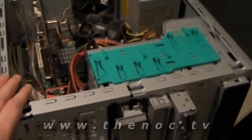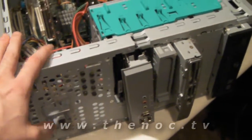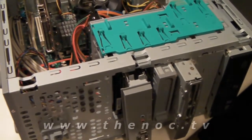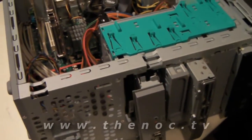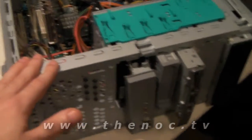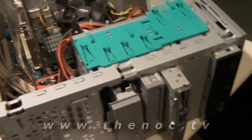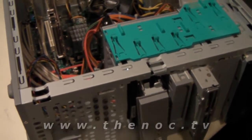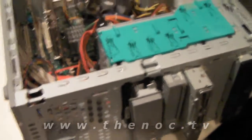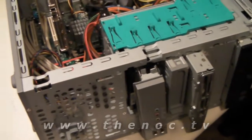You may have a computer that's starting up, runs for a few minutes and then it either locks up, freezes, or just powers off. That can be a couple different reasons for that. Your computer may also start up but not all the way — lock up in your BIOS — and in general might just run pretty slow. But the most common thing, especially for all of those symptoms, is dust.